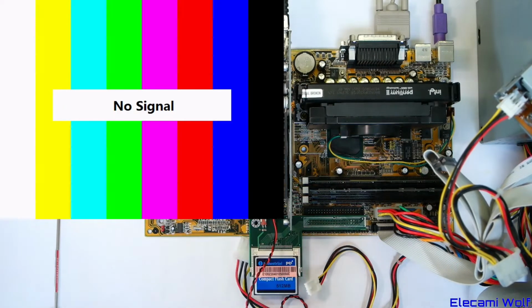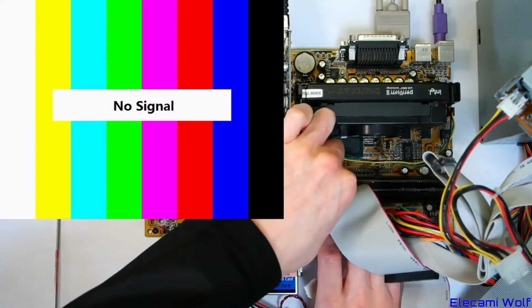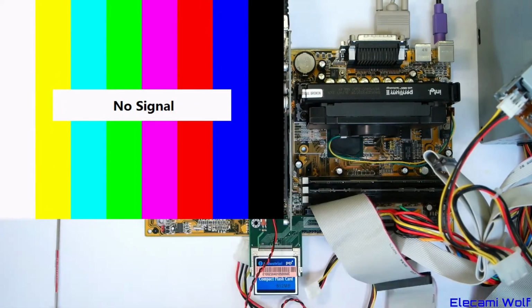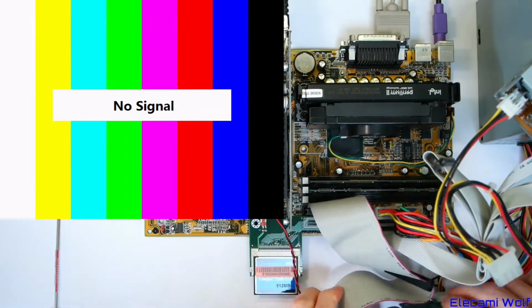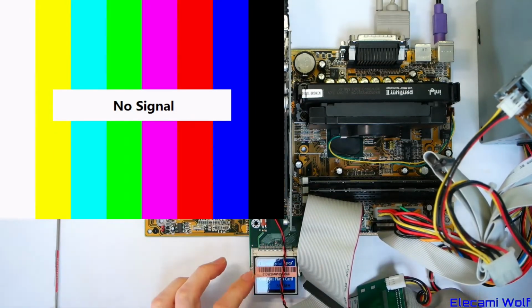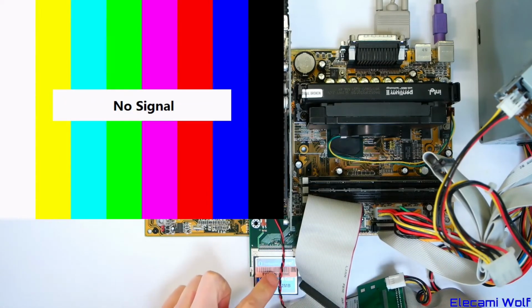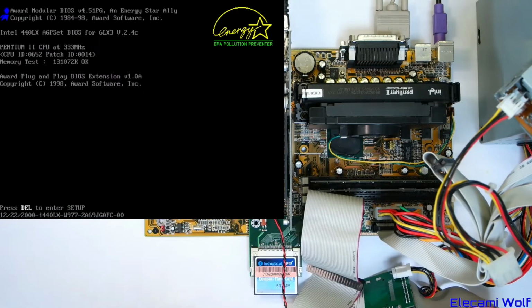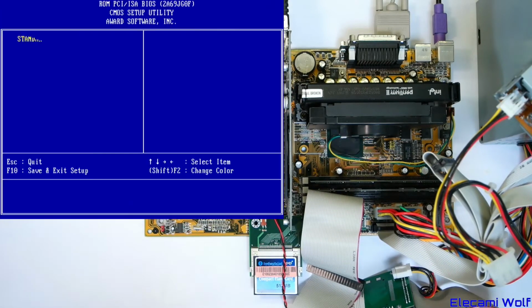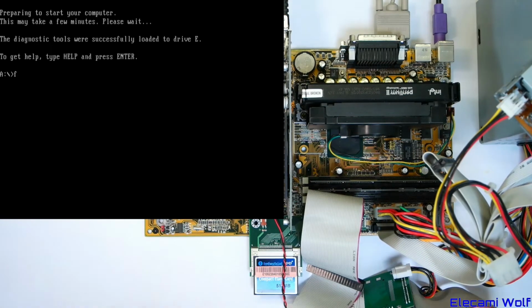So we'll just turn off the computer and we'll plug the second one in and we'll see if we can make a disk on that, and then we'll put the Windows setup files on the second disk because I want it to be... I don't think there'll be enough space on this one, I'm not sure about that. I just remember from before trying to set up a system on these size cards, it wasn't really big enough. So hopefully, now we've got to go into the BIOS and turn on the second disk now. Found both of them, that's good. F disk again, so that's all good.